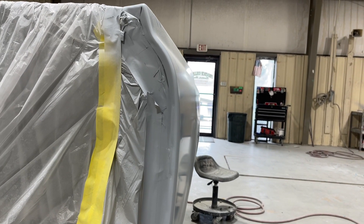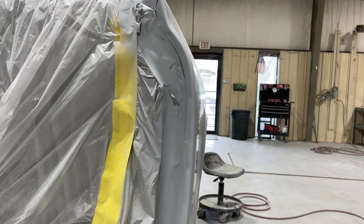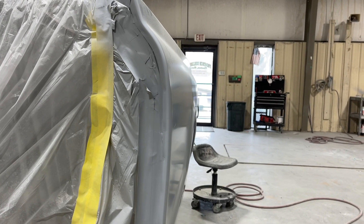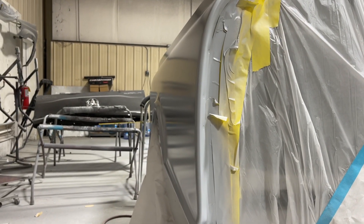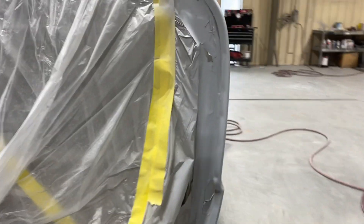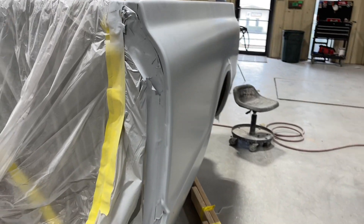The top of the bed needs a little more blocking and work, but looking down the other side it's great. Looking down this side it's got one of those long kind of waves in a couple areas. I don't know if you can see the wave I'm talking about, but when you look down this thing there's just a slight wave on each side of the wheel well opening that I don't like. I look down the other side — it's perfect, it's straight, there's no wave to it, just one long straight line. So let's work on this side for a minute and see if we can fix it.